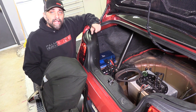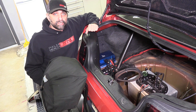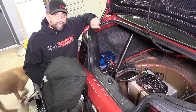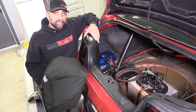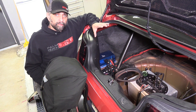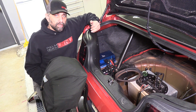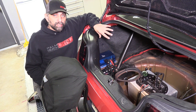Now I've used this setup for my 7-second pass and it's been on the car pretty much ever since the new turbos went on up front. I'm going to go over that log now because this setup most likely saved my engine on the 7-second pass. Here's why: this setup will always maintain pump RPM, whereas on a normal setup the fuel pump runs off system voltage — if you lose voltage, you lose fuel pump output. Not in this case. That's the magic of the controller.